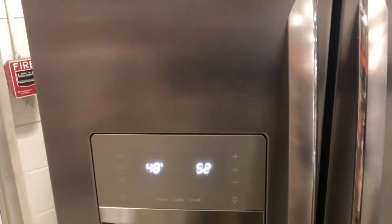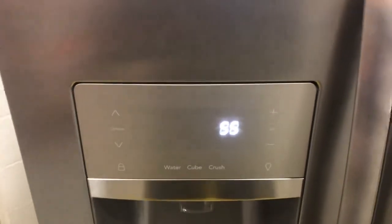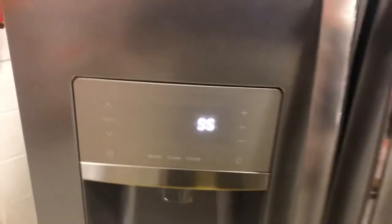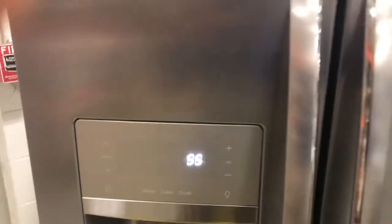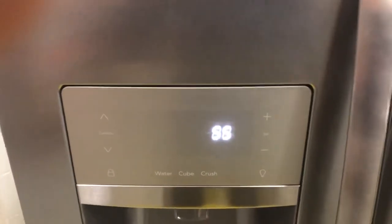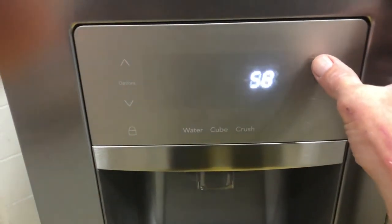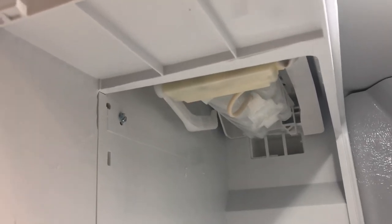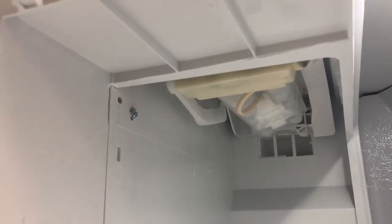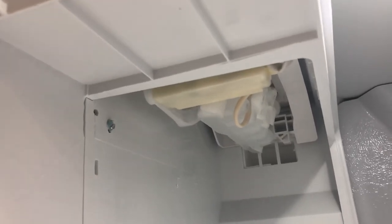You use the fresh food plus button to advance to the next test. That's test number 55, which activates the water valve to fill water into the ice maker. Before doing that, you should run test 58 first — if you have ice in your ice maker, you want to eject those cubes before filling with water, otherwise water will spill everywhere. Test 58 activates automatically and you can see the ice maker running through its cycle; if there were cubes in there, they would have fallen out.